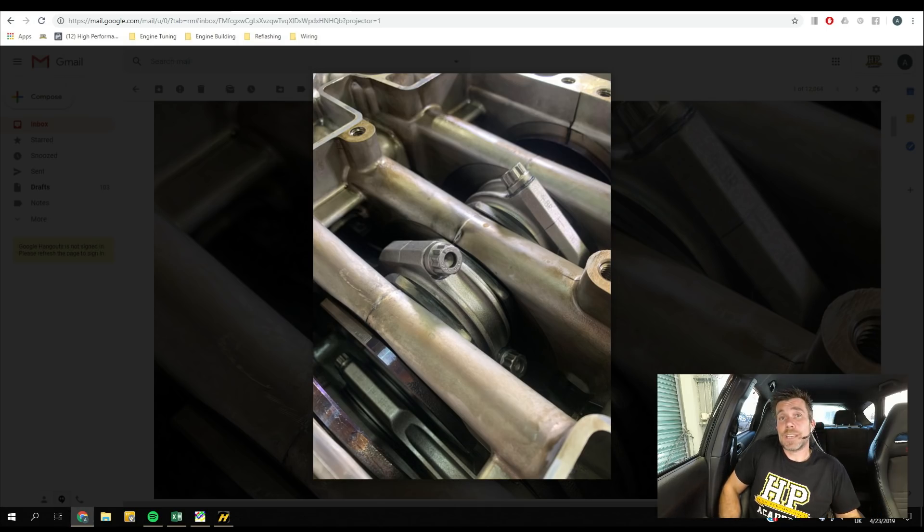What we've done is keep the factory cast pistons. People often ask why, and the reason is that while adding a set of forged pistons at the same time would seem relatively cost effective, the cost of the pistons alone isn't the biggest factor. When we add forged pistons we also have to have the engine block bored and honed to suit those first oversized pistons and get the piston-to-cylinder wall clearance correct. That extra work combined with our machining bill plus freight to and from our machinist really does add up substantially. So we're working on the basis of if it isn't broken, don't fix it.